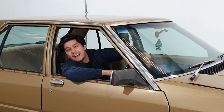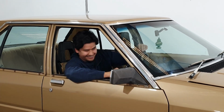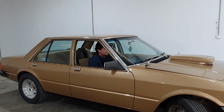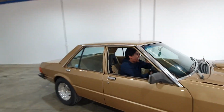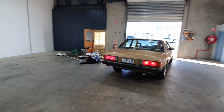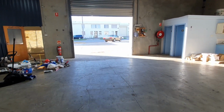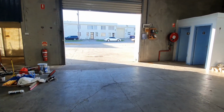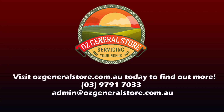Three coats of high fill primer in the booth, and my mate applied a lot of bog just to sharpen up the lines there. But once he had actually sanded it, there wasn't actually much bog on the car, and there he is outside our booth, and he's primed it again to cover all the bog. And we can see here, he's applied base coat. I think that's probably the first coat of clear coat. There's three coats of base coat, three coats of clear coat. There it is with the stockies on it. And then late night, we had spraying the underside of the sill.